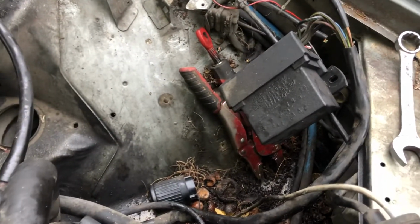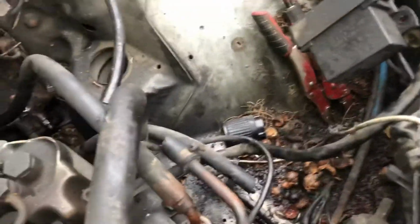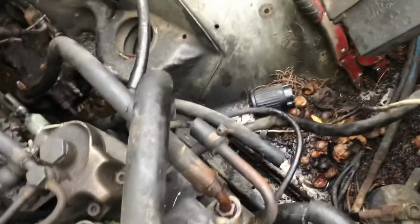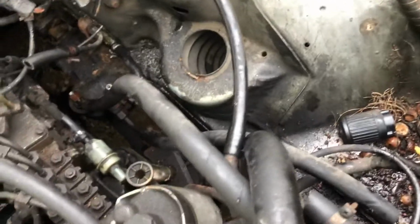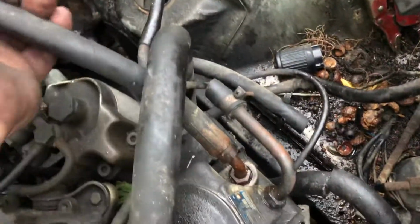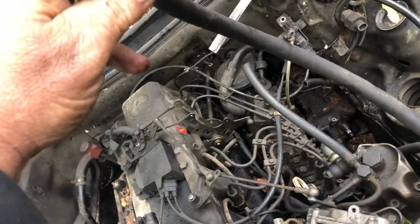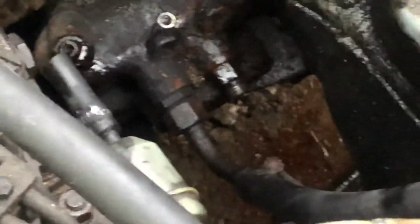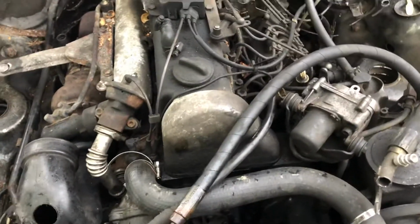Saving. The AC lines I'm not going to use. Even if we put AC on that truck, those lines wouldn't work. And I cut the return line on the power steering. It's just straight rubber hose, pretty much. The power steering pressure line did come loose, and it's some inverted flare, looks like. And I'll probably take that fitting out of the steering box down there, and there it is. And probably have to make something work to adapt it to the Dodge rack and pinion.